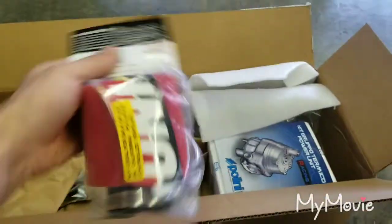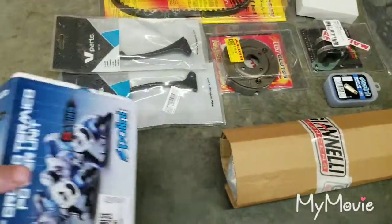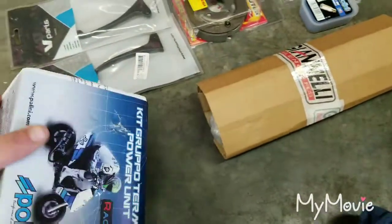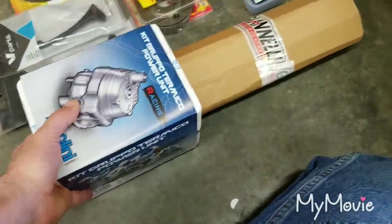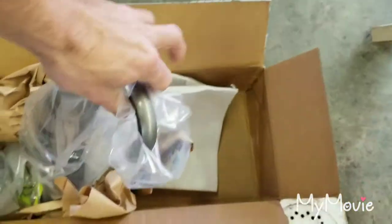I'll save the best for last. This looks like a silencer for the pipe — I think it's called Gianelli, that's the silencer. This is the uni filter that goes with the carb, we'll set that over with the carb. This is the Polini 70cc kit — that's the part number we decided to go for. I'm not changing the crank; I'm going to run the stock crank because this is not really a high-performance situation. I did buy high-end parts, but that was for reliability. You're going to get performance, but I'm more of a stickler for reliability than anything.